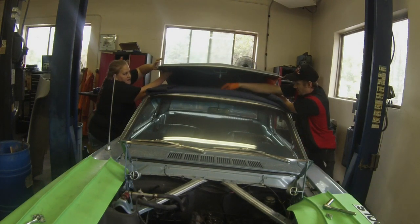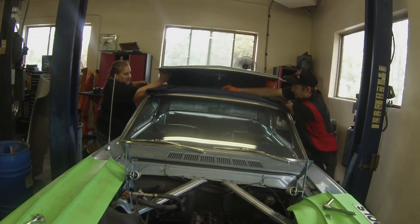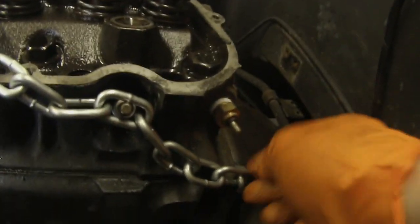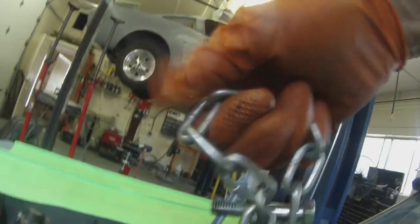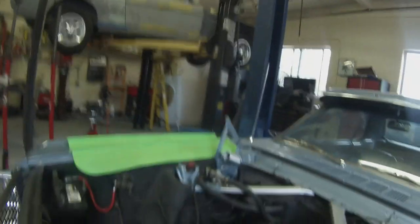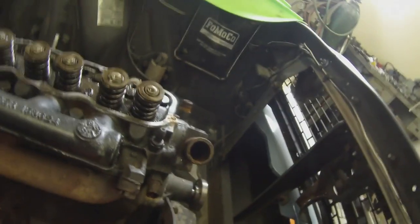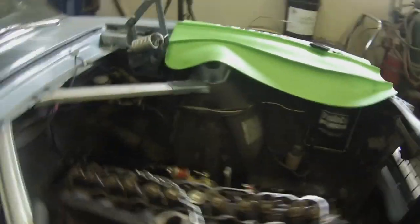This is what you have to watch — it has to be just hanging, and this cannot contact or else you're going to get damage — you have to go forward like that. It seems like we don't have a fancy lift plate for a six-cylinder, so here's what I've done: there's a bolt through the back of the block with a chain through it. This chain has a bolt and nut to create a loop, and we've come all the way across using the alternator bracket with a bolt through it. We have a series of hooks and chains, and now we have a pretty strong lifting chain to haul this thing out of here.